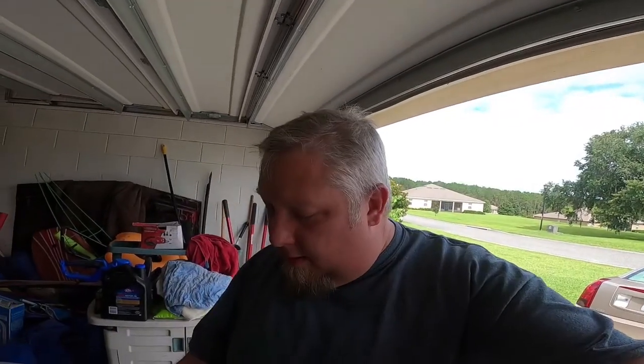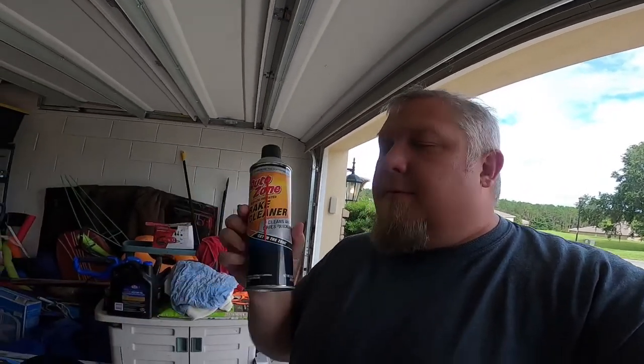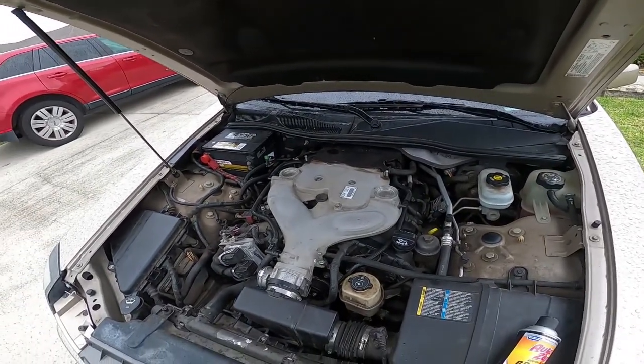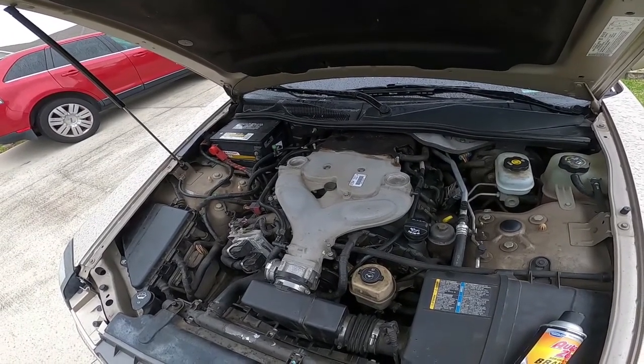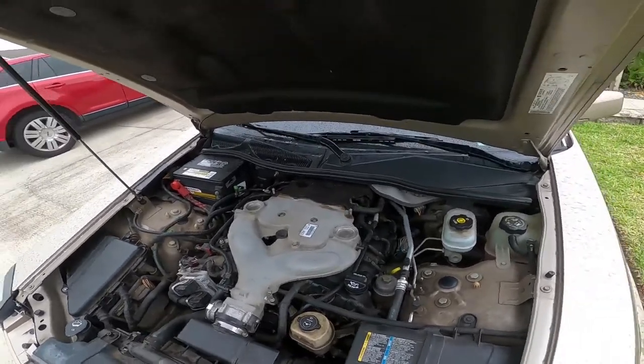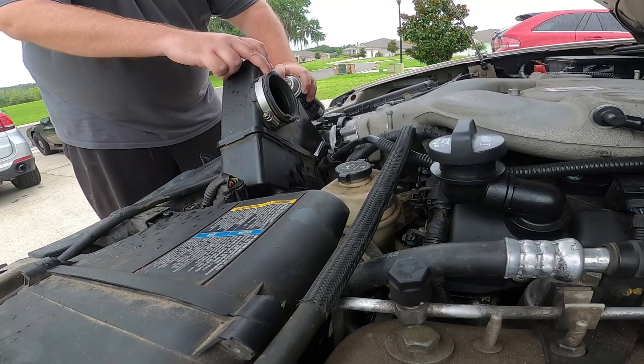So you can see what's happening - we have RPM, which means the crank sensor is working. If it read zero, that would be your first thing to replace and that should resolve your issue. But in our case there is RPM, so the sensor should be working. Next step is spraying starter fluid in the intake to see if it starts. Crank no start confirmed.